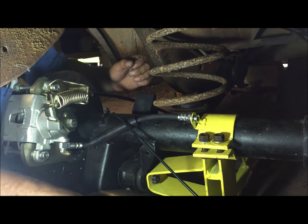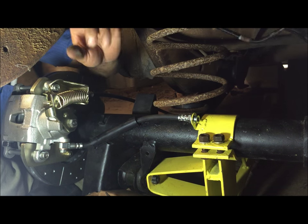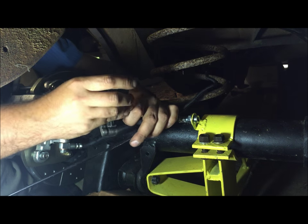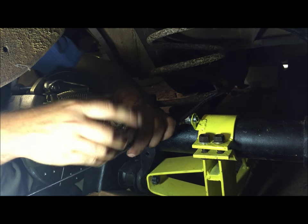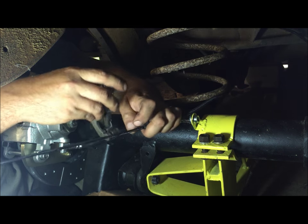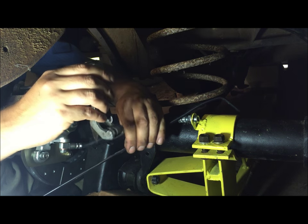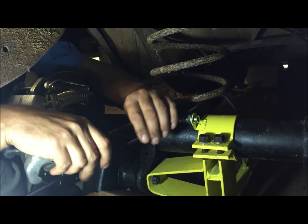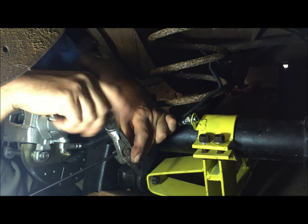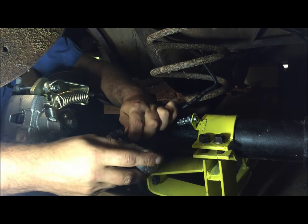Now we're going to modify this line. If you have this winding on here, you need to grind it off carefully. Then mark it exactly where you want to flare it — you've got bends right here, so plan your flare point. Disconnect the line from the car. I'm going to cut it with a little pipe cutter like this — you can get cheap pipe cutters at O'Reilly, there's a little red one they sell. Tighten it as you turn, but don't tighten it too much.